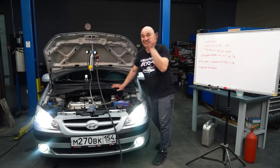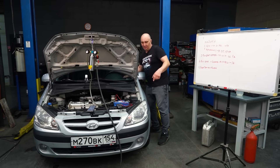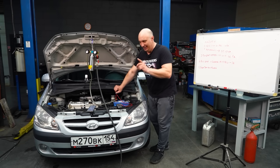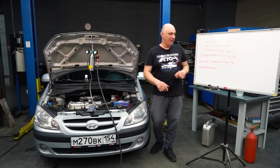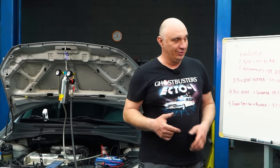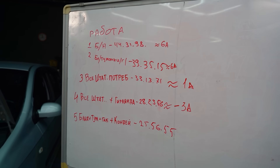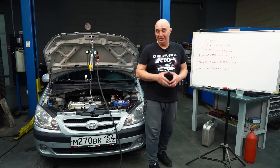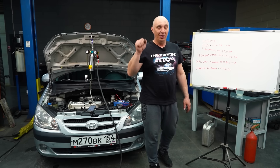With the AC and the headlights on — side lights, low beams, fog lights, and of course the AC — the engine lasted for 25 minutes and 56 seconds. The AC beat the alternator in terms of load on the engine. You can see all of the results: each time we added load, the runtime dropped by roughly 5 minutes, going from 44 minutes all the way down to under 26. That's it for this video — make sure to subscribe and comment. Catch you later.